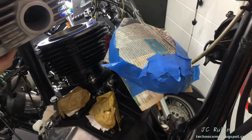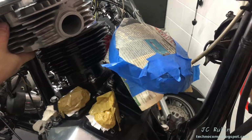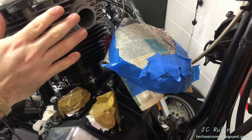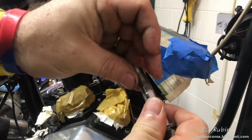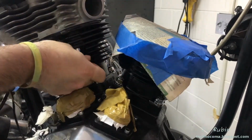The head is then fit into position over the cylinder, trying to approximate for the lineup of the holes that the bolts will then go through. The front facing of the rocker box makes this indication easy. That first bolt is finger turned 3/4 of the way. I take the next bolt, oil the threads, insert it, and turn that one 3/4 of the way as well.